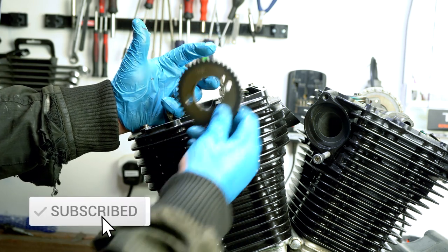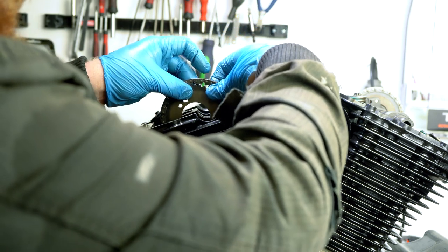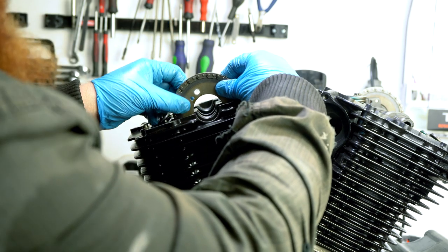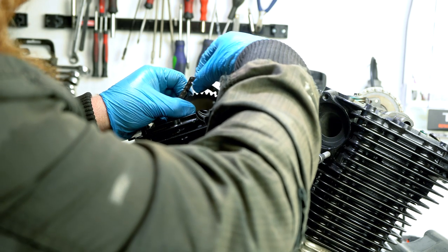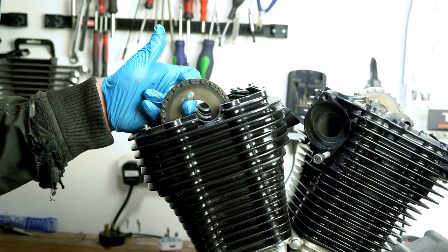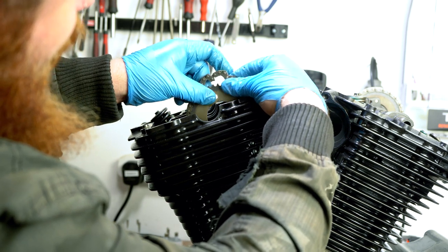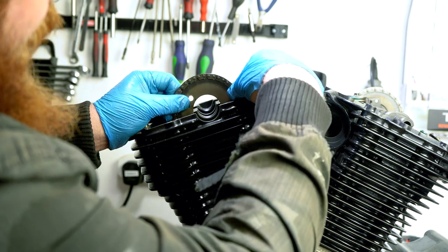Take the sprocket — don't drop anything — and put it inside here, getting the teeth into position. That's too high, that's more like ten o'clock. We need to come down a little bit. Take the slack off, drop it down into the engine, lift the chain up and move the chain across a few teeth. See how the sprocket went clockwise? We need to go the other way. Come down into the engine, lift the chain off, rotate the chain over. Do it one more time — maybe two more teeth. There we are.